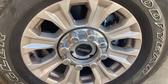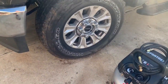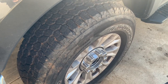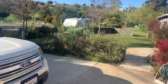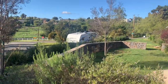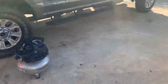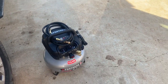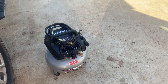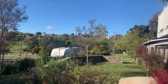You're going to find these on a lot of big trucks. I have a 2020 F250 and it comes stock with these tires. If you're going to be towing big loads you'll want tires like this. My toy hauler — which is down over there, a Pacific Coachworks Region 27 FXB — when it's fully loaded it's about 10,000 pounds, running a double axle with E-rated Goodyear Endurance tires.